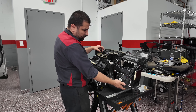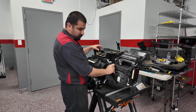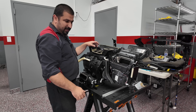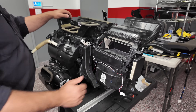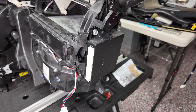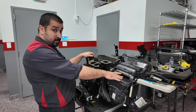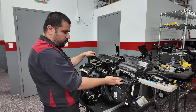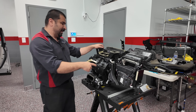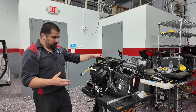This section here is just the blower motor case — here's your cabin filter, the one you see when you pull it out behind the glove box. Very simple. We don't have issues with the ECU. We already did testing — this door here is visible, you can actually see it activating, you can test it, both hinges are steady, and we don't have issues. The problem is inside the HVAC box.